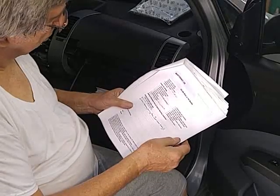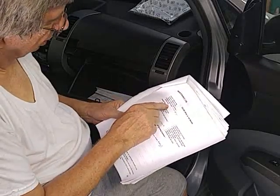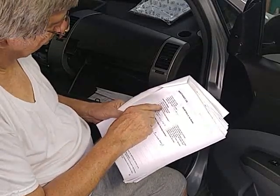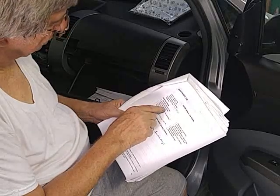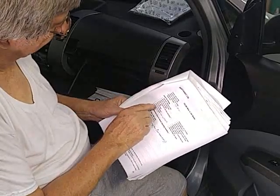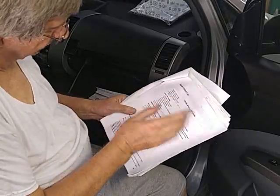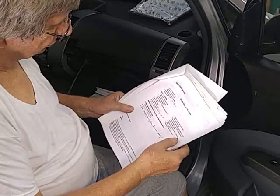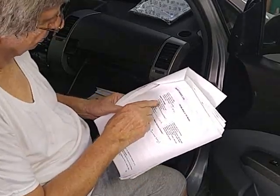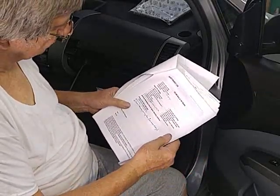But of course on here it's the cabin filter, engine filter, which we just did, oil and oil filter, rotate the tires, automatic transmission, and of course just check the ball joints and dust covers, and brake line. Just look at everything under the car and see if anything. And I just changed the drive belt. And it says engine valve clearance, but you don't have to worry about that unless you're hearing a pecking noise. Then you probably want to do that. Of course, check the exhaust and front differential. That's the same thing on these cars. That is the transmission, or differential, whatever you want to call it. It's the same thing. You change it, you change both of them.